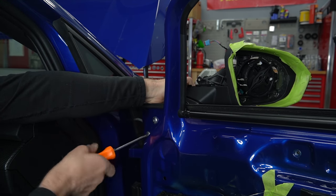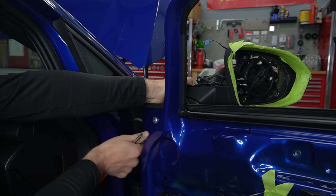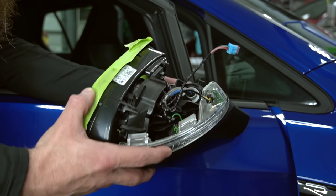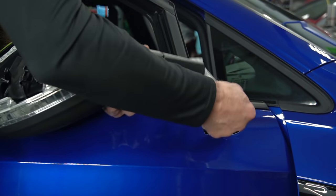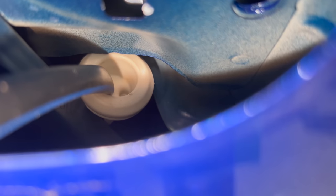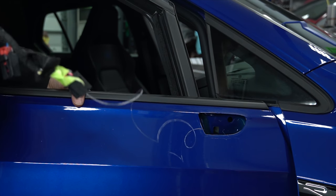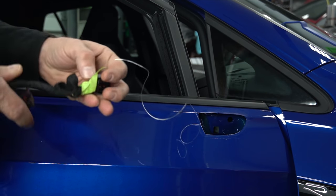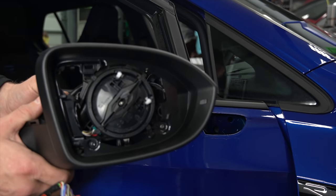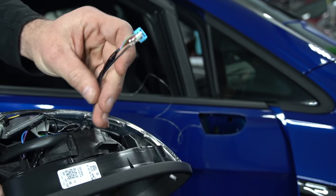We pretty much have everything out — our connector is loose and shoved through the door as much as possible. We have two T30s right here that we need to take out. You want to support the mirror on the front so it doesn't go flopping out. There is a clip that holds it in but don't risk it — just hold it. Also a good opportunity to clean behind that mirror housing. Now that we have it unbolted, carefully wiggle it loose so you don't scratch your paint. Then we need to feed our wires through — you may have to reach around the door. You can see the wires go around the window track, so get your wiring out. Make sure you don't pull your fishing line all the way through the hole, otherwise you're in a dilly of a pickle.